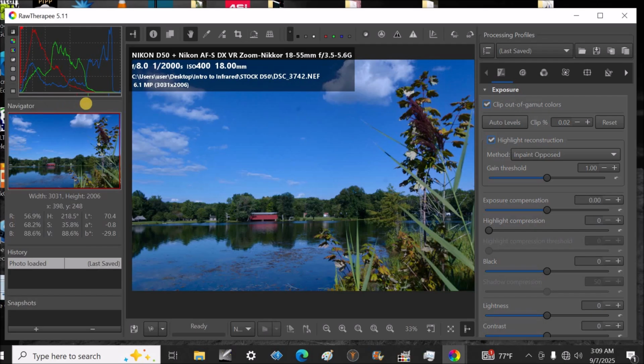And then it has an internal filter in front of the sensor in the case of the two Nikon cameras. The other one, I guess it's just filtered apparently with the lens, just with a coating on the lens. And that filter, all it does is it passes the light that our eyes see and blocks the infrared light and the ultraviolet light, which the sensor of the camera can see. So that's the whole trick there: when I convert a camera, I remove that internal filter.